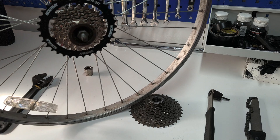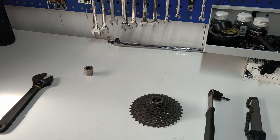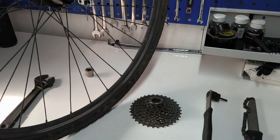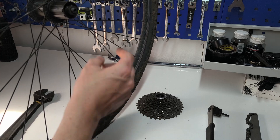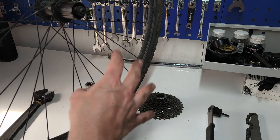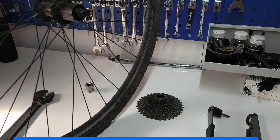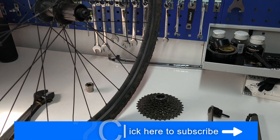That's your main difference: the freewheel has the clickety-clack function built in. When it comes to the higher end, there's more manufacturing time and science going into the freehub and indeed the cassette as well. The cassette doesn't have the function built in, but offers more versatility, more efficiency, and actually more longevity. With freewheels, they're much cheaper to buy and typically found on lower budget bikes.